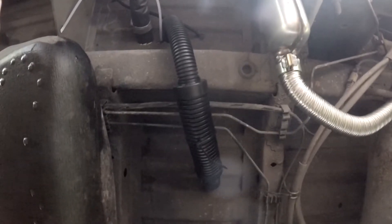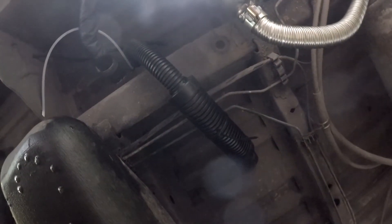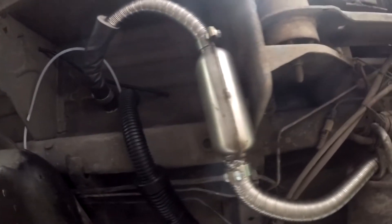The white is the fuel line, and the black one is the fresh air intake to the heater — the combustion part of the heater. And then we're going to look at how I do the fuel line, because the fuel pump has to be situated upwards.